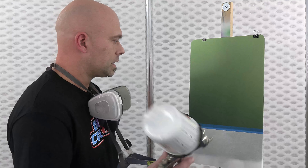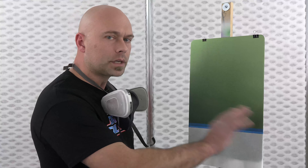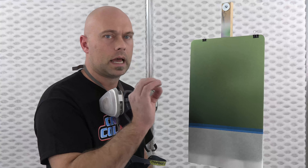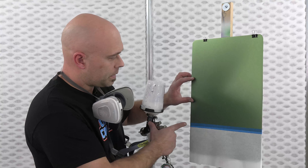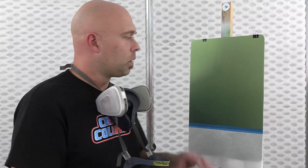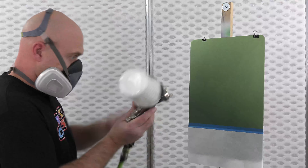Welcome back — it's been about 15 minutes, my clear is on the gun, ready to spray. The panel is our Wicked Metallic Fastback Green — a pretty cool color. I taped the bottom off so we can see the difference between the uncleared and cleared version. We'll spray three coats of clear. This is going to spray the same as a urethane clear. I want to keep a nice medium wet edge — just a slight blue tint, not milky, not hammered on. Use a 50% fan pattern overlap.